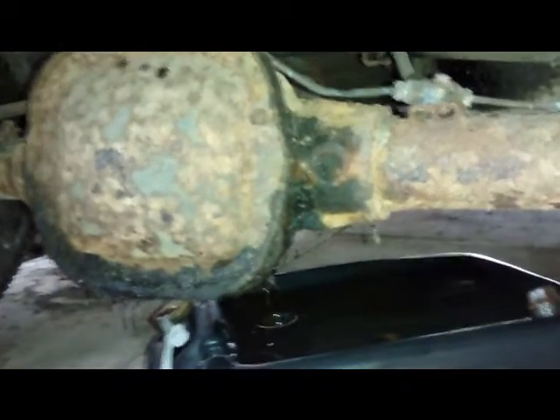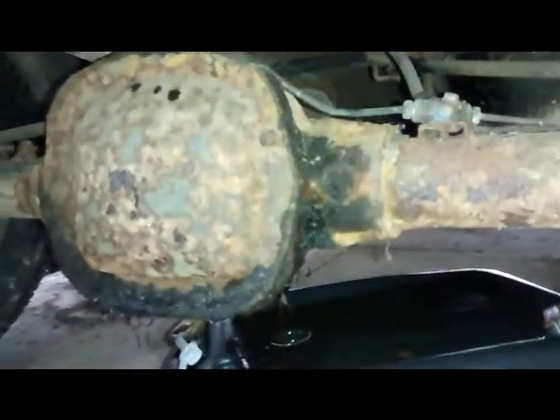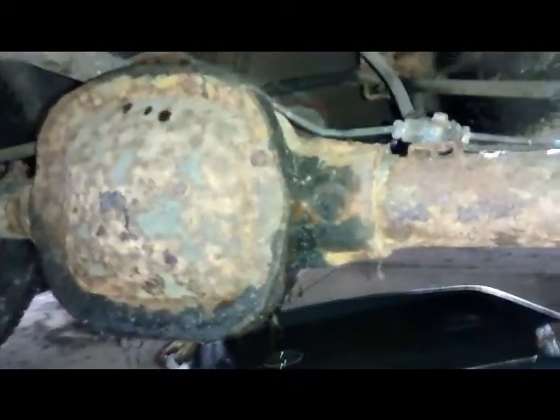While I'm waiting for the oil to drain, I'm going to assess the quality of the oil, more from my own records than anything else. As you can see, there has been oil seeping out at the bottom of this diff cover here, or sump. It's only held on with these bolts. I have got a new one from Parts World — they have some brand new old stock, which I've been very pleased with recently.